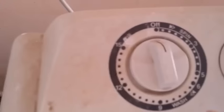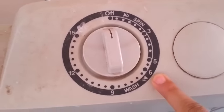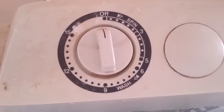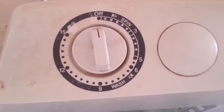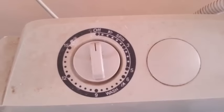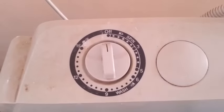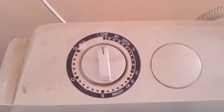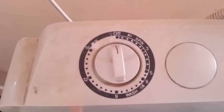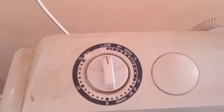Here you can select the timer. Up to 6 is the spin time — that's the minimum spin time needed to dry properly. After that, the wash starts. For small or soft clothes, 9 minutes is good enough. For heavy clothes like jeans, curtains, or bedsheets, it should be at least 12 minutes and can go up to 15 minutes, or you can double the cycle for a next round.